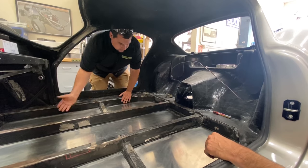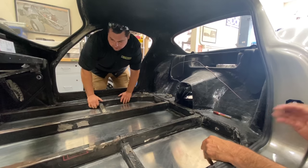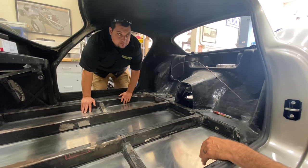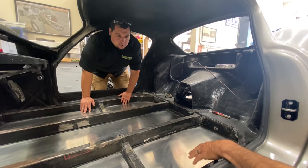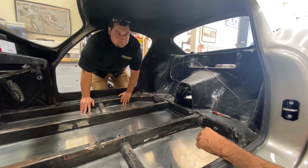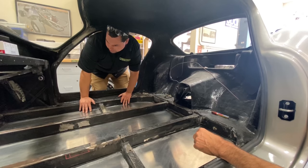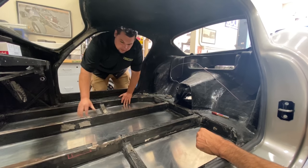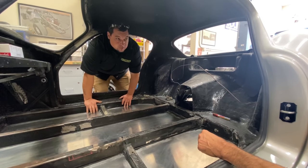We got a nice smooth pan on the bottom, and now we're completely sealed. The battery box is also sealed, coming in from the top. Going from fiberglass to aluminum has probably improved the torsional flex a little bit in the vehicle. Adding this actually added a lot of structure because it's panel-bonded, riveted, and sealed all along here — it really made this thing pretty stiff.